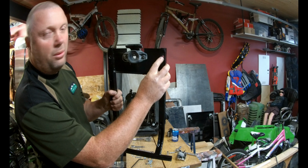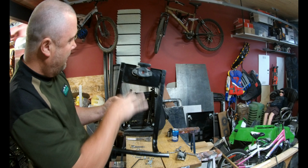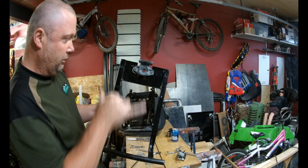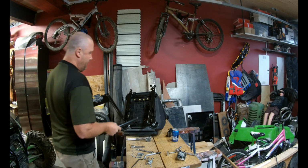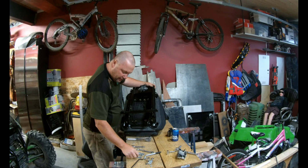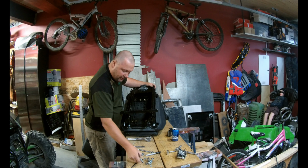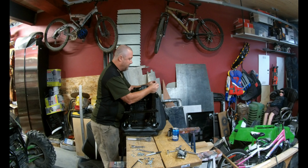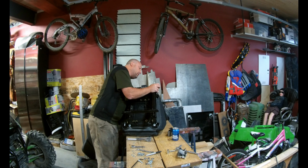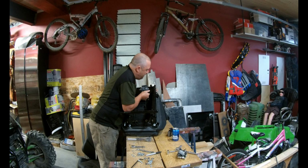So what I've done is just drilled out the holes. Here's the originals, just to fit the slider. Different width, so I've opted to drill about the back. See if she fits. Also I had to change the bolts out from these coach ones they've given us, just so you get the clearance through the slider. I think these are 40mm, 8.8 metric, keep everything metric on it.